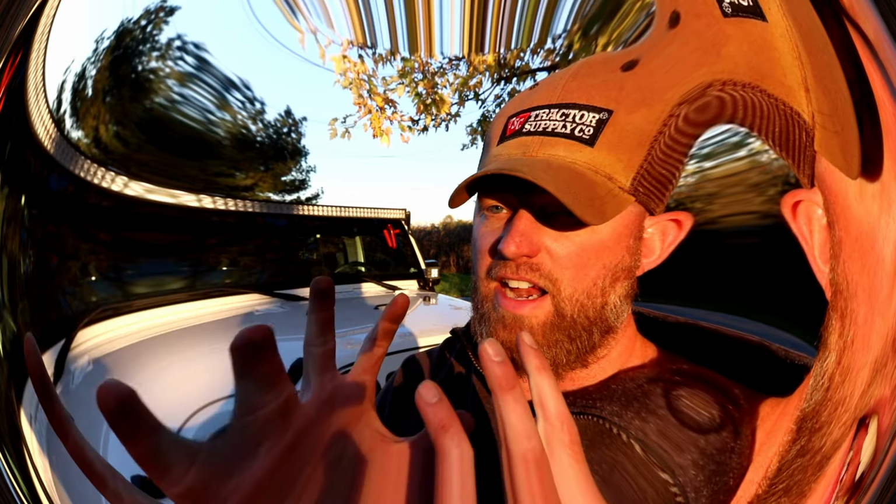Bleeding your system. Open up the bleeder. Open up the radiator. Open up the overfill. Fill your radiator until you see it coming out of your bleeder. Close your bleeder. Start your car. Let it run up, build pressure. Run your heater full blast at the same time. Then go and crack your bleeder just a little bit and it'll hiss and spit a whole bunch of air, taking all that air out of that system, and your heat's gonna start working wonderfully, just like this one is again. Close the bleeder back. If you need to top off more or whatever, you shouldn't, you're good to go.